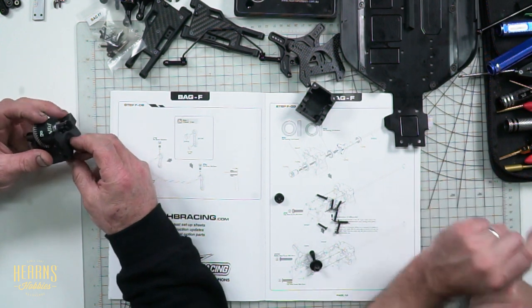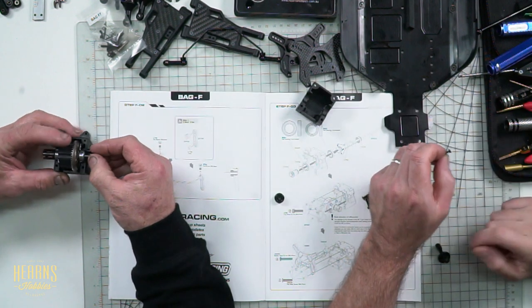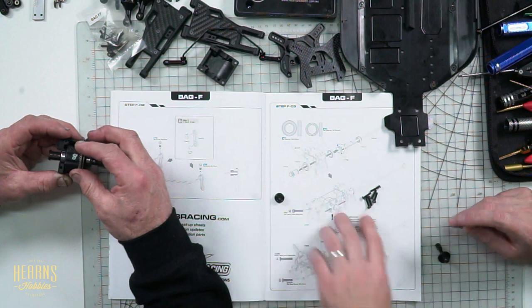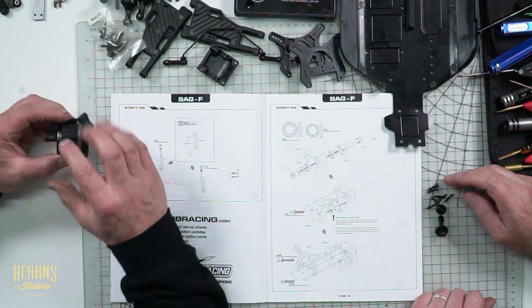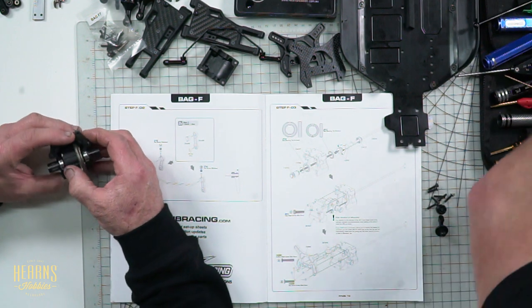Where are the shims? Can you hear it? It's riding all wrong. That's not nice. Turn it over and put it on the other side. Look at the float. There should be two shims on this one, so you need a shim on this side. There's usually two shims.